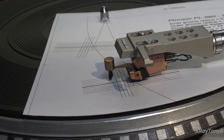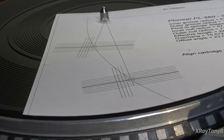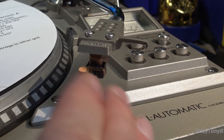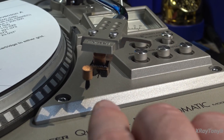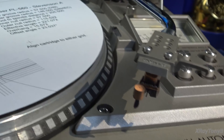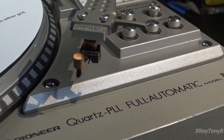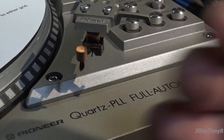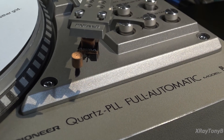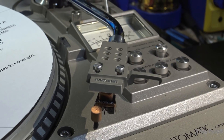The next thing you want to look at - which I'm not going to do on camera - is azimuth. That probably won't be off; it's usually pretty close as long as the arm isn't forced. What is azimuth? If I turn this around like this - azimuth would be the roll axis, this rotational axis. What we want is for the stylus to sit straight down in the groove - we don't want it tilted left or right. The more accurate your stylus - when you get into the elliptical stylus or the line contact stylus - the more critical that azimuth adjustment becomes. A very low-end conical stylus is a little more forgiving of that. In general, a conical stylus is going to be more forgiving than any of the other types.